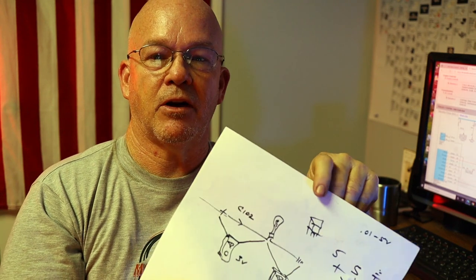Some of the terminology can get confusing. For the first few years of my career I had a really hard time digesting what resistance, voltage drop, short, and open all meant — that's why I'm making this video. You can't see electricity, so you've got to rely on a good voltmeter. A test light will tell you if the patient's alive, and it's pretty handy and quick, but it doesn't tell you the patient's condition. It's better to use a voltmeter if you can. If you do get a test light, get one with an incandescent bulb — you can also use it to put small loads on circuits and see if the circuit can carry a little current.